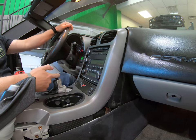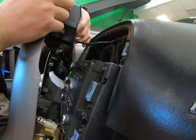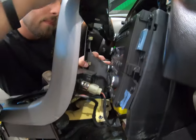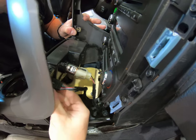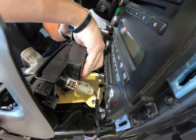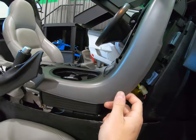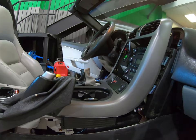A little tip: put it in neutral, just drop it down. It'll be a little easier to slide it back. You're going to slide this back and then disconnect all the harnesses. You're going to have to feel around for them. I came around to the other side just because I couldn't see the one for the cigarette lighter plug back there. Just disconnected it, so now everything's loose. We're just going to take this and swing it up and over the shifter and swing it over to the side so it's out of the way.